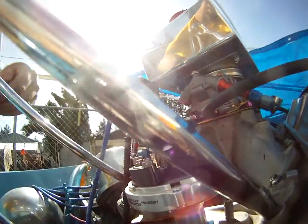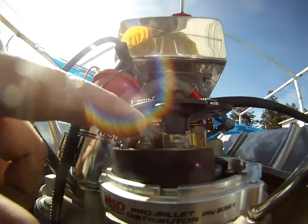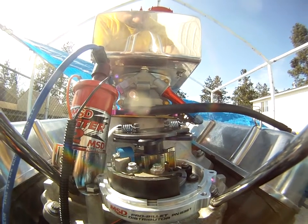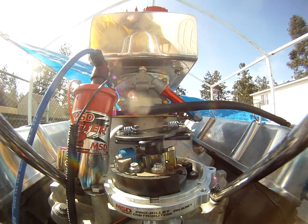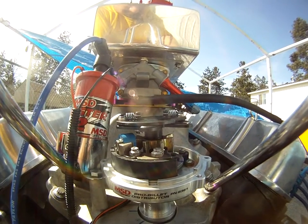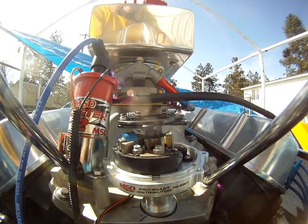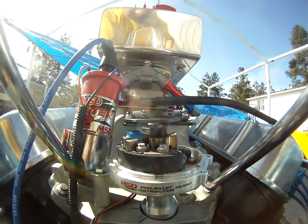There's a bushing that goes under — it's on the other side where the screw is. I always run the blue bushing — the blue bushing is 21 degrees. I usually run the blue springs or the blue and the silver. So let's say you have a small block Chevy running 13-to-1 compression and 92 octane — you're going to have detonation. To help avoid detonation, put stiffer springs on it. If you're running a 10-to-1 small block or a big block, you usually start with the heavy blues and you can go to blue and a light silver. I'm starting with two blues and may end up with a blue and a silver. The light silver spring combined with the blue is 2500 RPM total advance with the blue bushing, and that's probably right where you'd want to be on most engines.